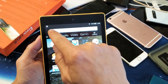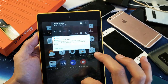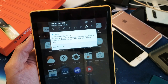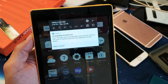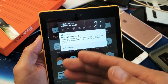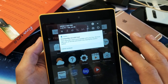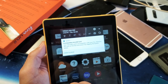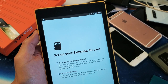Anyways, I can see the SD card here right there. So now I'm just going to go ahead and slide down right here, and it says — I have an error message. Incompatible micro SD card. Your micro SD card is incompatible with your Fire. Remove the card or format and erase it by tapping on the button below. I'm going to go ahead and format and erase. Don't forget, guys, when you format an SD card, basically you're erasing or deleting everything that's on there. So I probably do have some photos and videos on there from my phone. Anyways, I'm just going to go ahead and format and erase right here, and tap on this just like that.